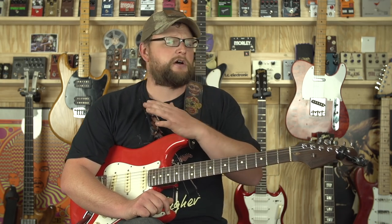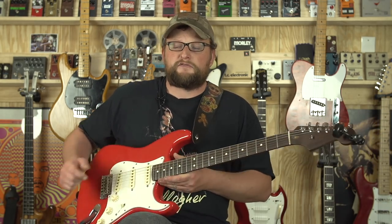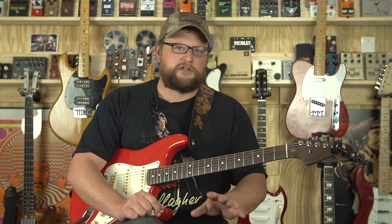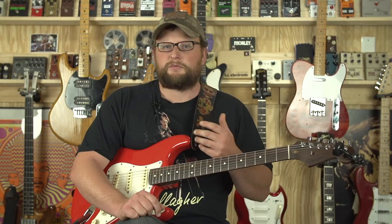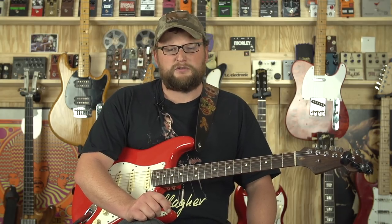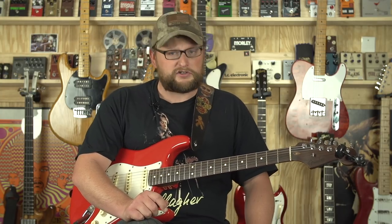You do not want to go higher or lower on the humidity. If you start getting too humid, you'll get excessive moisture buildup in the room, and you can get mold on your speaker cones, mold behind picture frames, mold on your guitars themselves. You do not want mold — mold is the enemy. Remember, a lot of the speakers in vintage amps are made out of paper cones, so that paper can attract moisture and can mold. If you have a vintage amplifier collection you've worked hard to invest your hard-earned money in, you want to protect those investments.